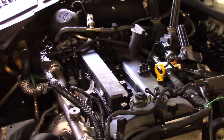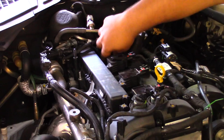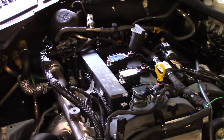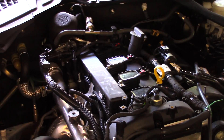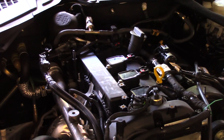Alright, so with the spark plugs inside now, tightened at 18 foot-pounds of torque, we can go ahead and put the coil packs back on and tighten them back down. Now that everything is buttoned back up and everything is tight, we're going to close the hood, take another quick look at everything — EcoBoost. Okay, close the hood, start the car and we're done.